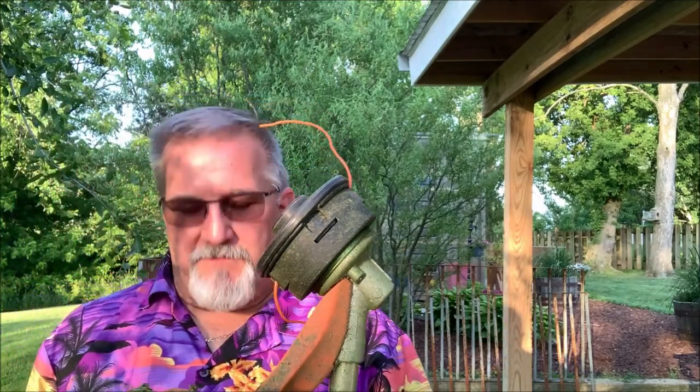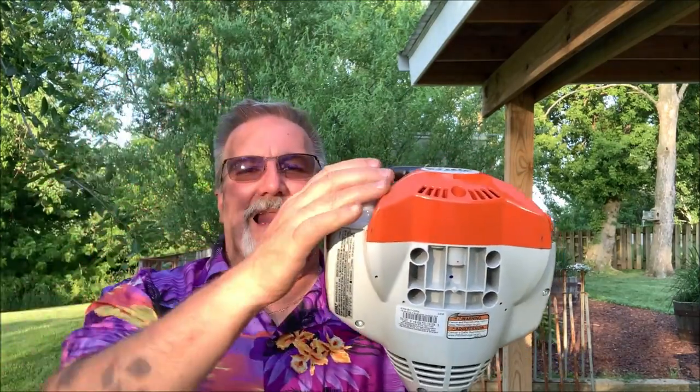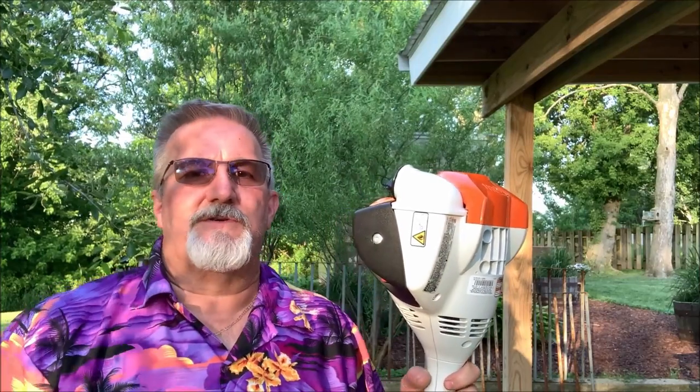And this one, I have a feeling, if you do everything I've done, now what I always do, folks, fuel. Run the recommended fuel, 50-to-1 mixture. I like the full synthetic stuff. STIHL, that's a great bargain with STIHL. You buy a 6-pack, you extend your warranty by one more year. It doubles to 2 years.